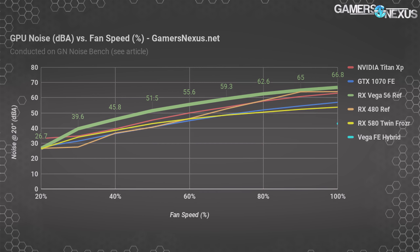We really have to look out for AIB partner cards later to find something with improved cooling. That said, the VRM is good, so it may be a good water-cooling candidate if you want to dodge the cost of AIB partner cards where you pay for something you're not going to use.